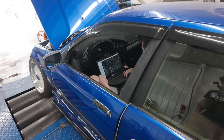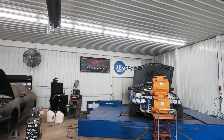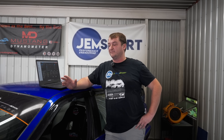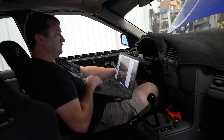Coming from an OEM ECU to the NEO 4, there are quite a few things we couldn't accomplish before. A lot of the fun things are rev limiters and all the pops and bangs, but also having control over that sort of thing. The OEM ECU would just cut all your power at the rev limit and it wasn't the easiest thing to drift or drive in general. Now we can get pretty accurate control and get it to do exactly what we want. We also detected some pre-ignition on cylinder four pretty early during this tuning session — whereas the OEM ECU may have missed it or reacted in a way that we couldn't have made the proper corrections.